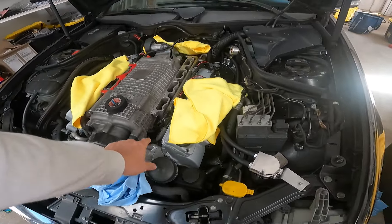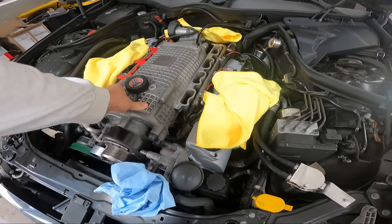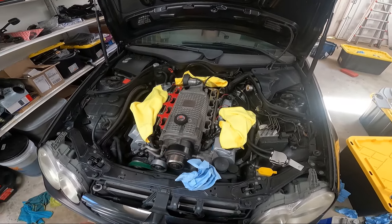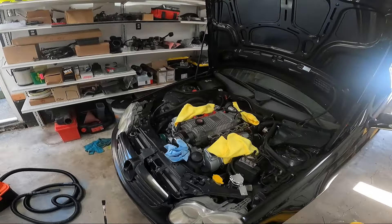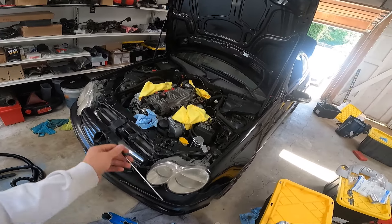Shout out to Wishmaster, a subscriber that commented last time and reminded me that I forgot to tape up the part of the harness that was exposed. So I had one of my biggest brain moments ever and remembered they make this stuff called liquid tape. I used it to repair the harness by sneaking in there with a custom-made extended paint brush. I layered it on pretty thick, made sure I covered up all the spots — did like three or four layers, letting it dry an hour in between over the last day. Yeah, it's all good now.